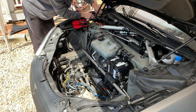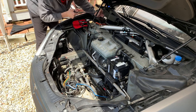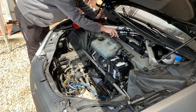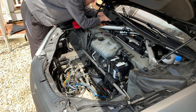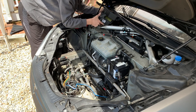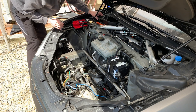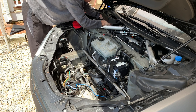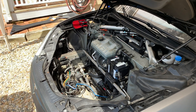Now I've shifted focus to the high voltage disconnect loop. This is a dual motor car so it's in a different location. You're going to remove two plastic tabs and then two 8 millimeter bolts to remove the air filter housing out of the way. You have to do all this just to be able to disconnect the high voltage disconnect loop. The only reason you really need to do this is that after you replace the cluster screen, you have to reset the system.